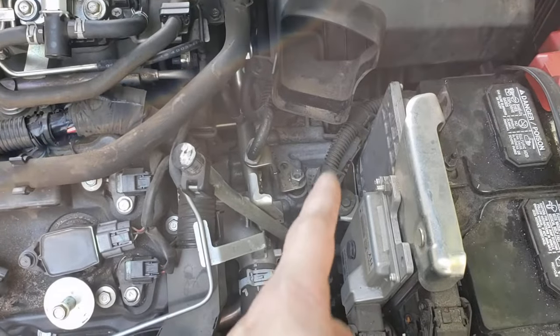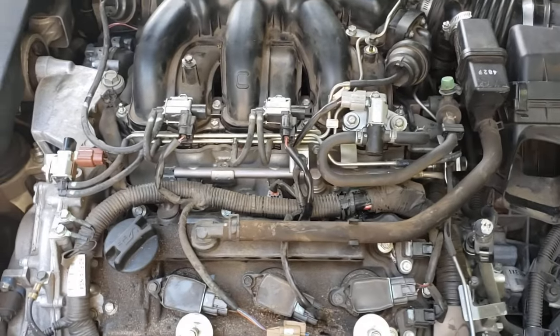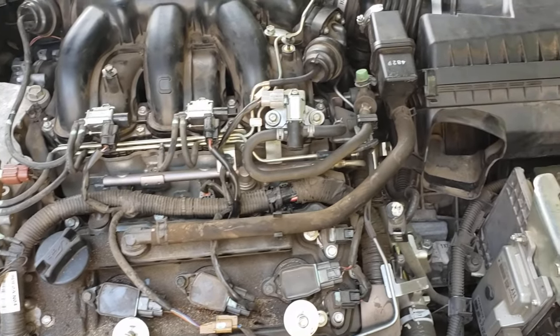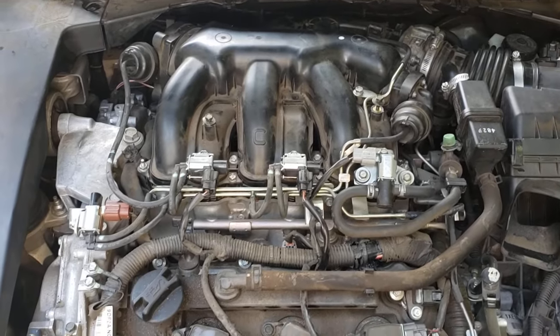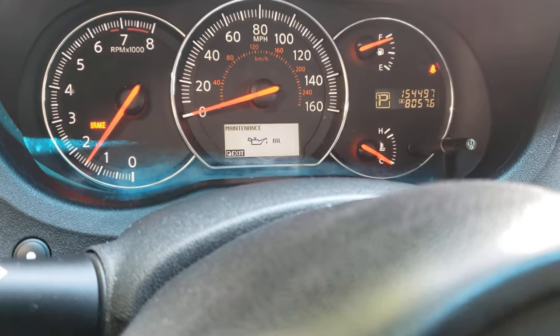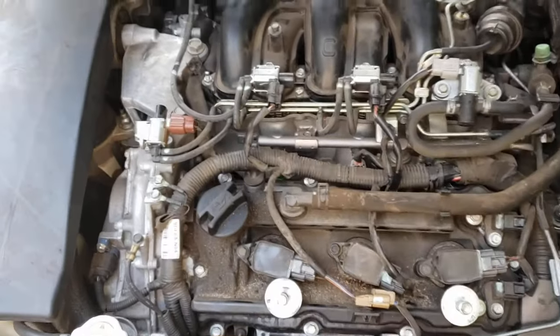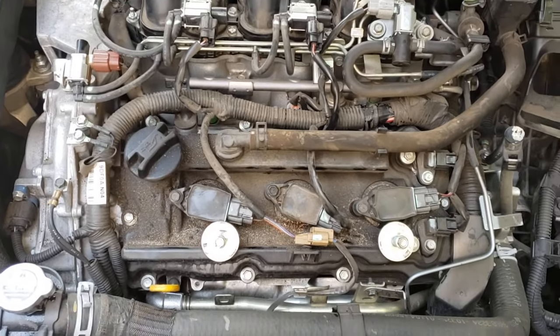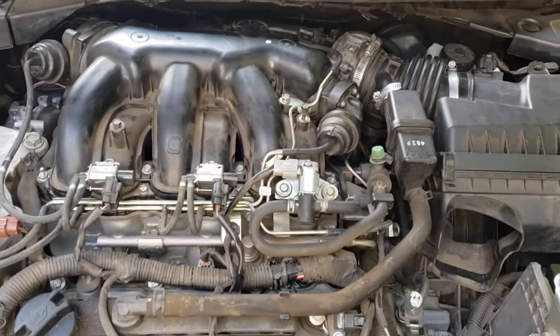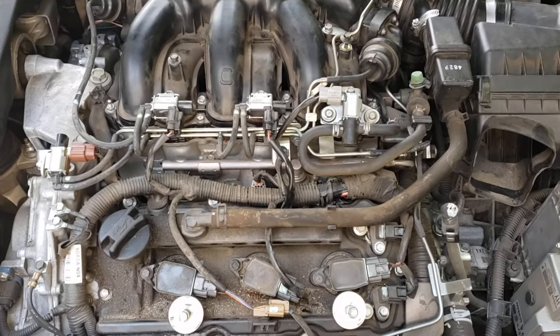You do not need to hook up the front snorkel or place the engine cover back on yet, because you want to start it and make sure there are no weird noises or check engine lights. Double-check your work, make sure everything is back where it's supposed to be and nothing's loose, then start the vehicle. The vehicle started right up — it just has the oil maintenance reminder on, so we will change the oil next. Everything sounds quiet and smooth with no weird noises. Just let the car fully warm up, make sure you don't have a check engine light, and that's all it takes to do a tune-up on these V6 Nissans and Infinitis. Hope this helps — thanks for watching, please subscribe.